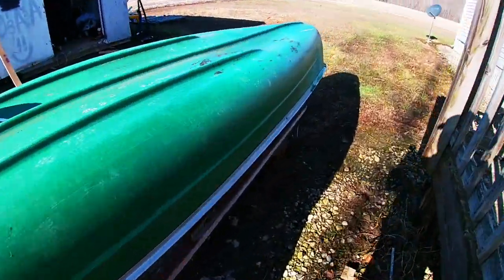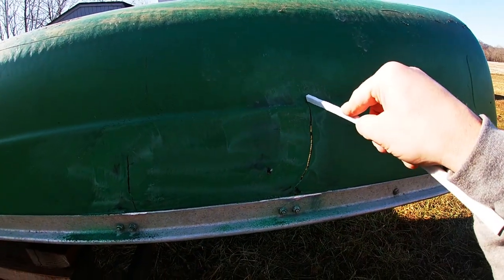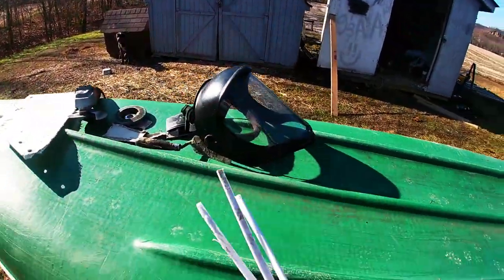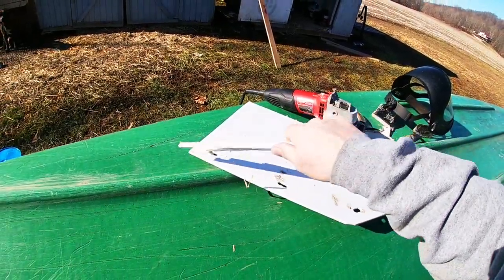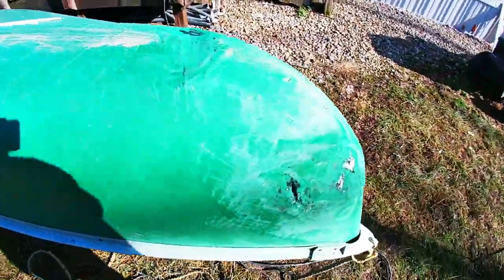And then back here where I had a couple cracks, I got them all cleaned up. I'm just going to try to heat this up, weld in that crack, weld in that crack. I got plenty of mud flap here and some more pieces cut. All I done was took that grinder — it's got a cut-off wheel on it for metal — and just cut that strip out. The good thing about plastic welding is if you mess up, you can sand it down and do it again.